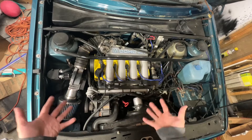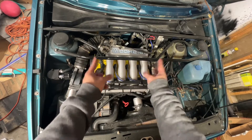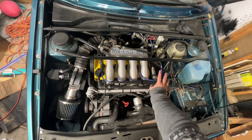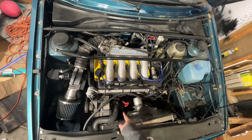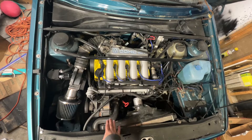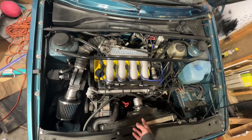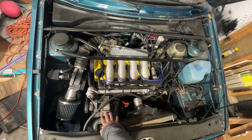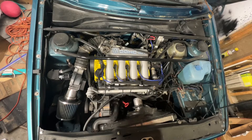So now we're in the garage. To fit the carbs, we're going to have to take off the intake system, the intake manifold, ISV, fuel rail. We might have to drop the alternator down, and we'll see if the coolant line gets in the way — that's why we bought the water neck, just in case. So without further ado, let's just get busy.